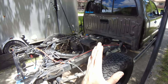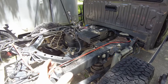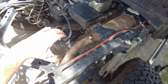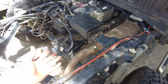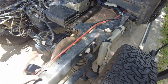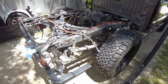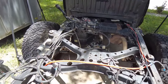Why is one shock leaning forward and the other leaning backwards? I'm pretty sure that's something to do with controlling axle wrap. When there's a lot of torque going through this axle and a lot of traction at the tires, the axle tube will want to push down and then spring back up because there's no damper to control that. They're doing it by offsetting these shocks to control what's called axle wrap, which is where your axle twists. Anyway, that's why they're staggered.